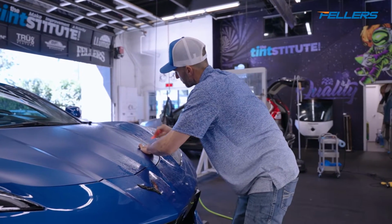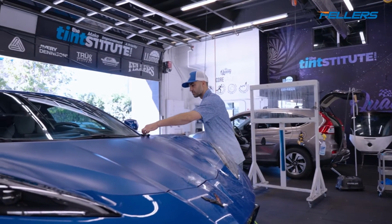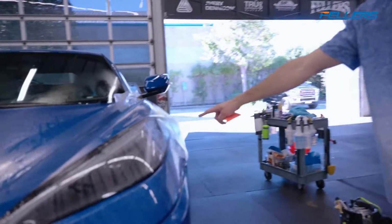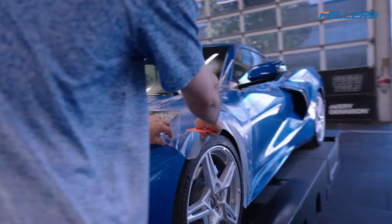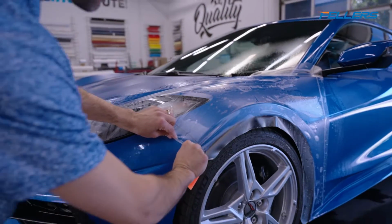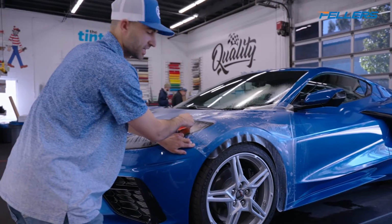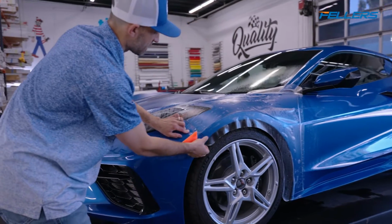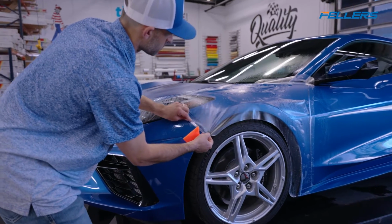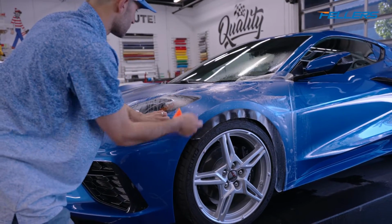And then I'm tacking to the bumper. Okay, this is all smooth through here. Now, come around here, and you can see we have another big issue. Okay, so where do I pull to get that out? Right there. As I do that, I cause another little issue, a little finger right here. So I need to pull towards me and down towards my right foot. Okay, it's smooth along this wheel well, and it's smooth along this headlight.